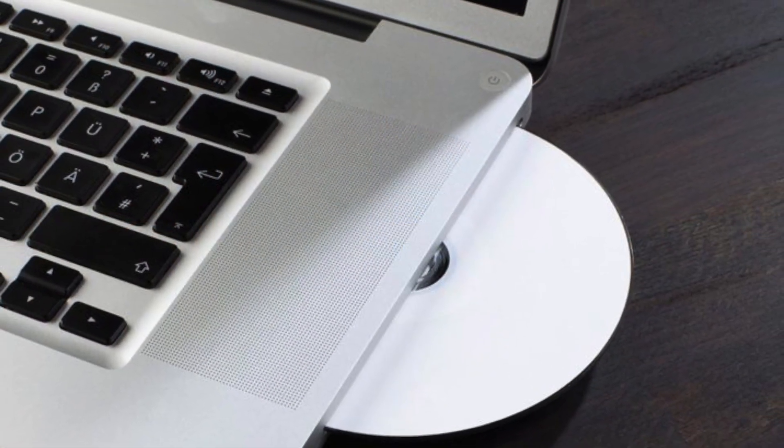I'll be taking the Mercury Extreme Pro 6G hard drive to install and replace the system drive. We're also going to take the old optical drive out of the laptop — the one you used for CDs or DVDs, which we don't need anymore — and replace it with the OWC Data Doubler SSD drive caddy, put in the Mercury Electra 3G hard drive into the caddy. We'll also use the OWC SSD Express Enclosure to connect the old hard drive and port over all data and files to the new drives.